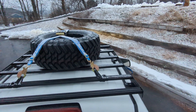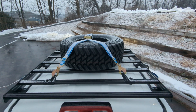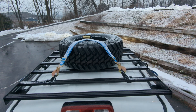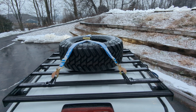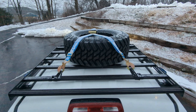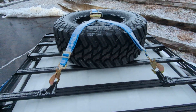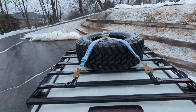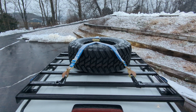I noticed one drawback, and it seemed I was the only one with this complaint. Prior to putting the spare on top, I had a horrific reverberation — a vibration. I thought my front end was going crazy, and for a few weeks I couldn't diagnose the problem. What was actually happening was with no load on top of the rack, the bars up front were vibrating, shaking the dashboard and the front of the truck.